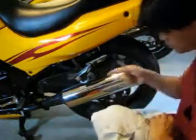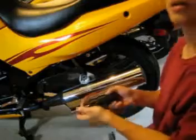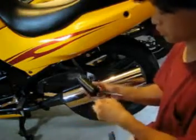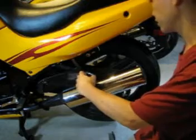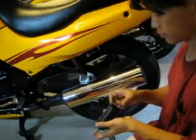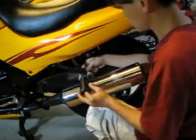I've got the bike on the center stand, so there's really no strain on the chassis here. What I'm going to do is remove this bolt here. As you can tell, the screw that comes with the frame slider is much longer — and it makes sense, because the original one will only fit so far and certainly won't reach the other end. So I'm using the one that came with the frame slider and inserting it to make it all the way to the other side.